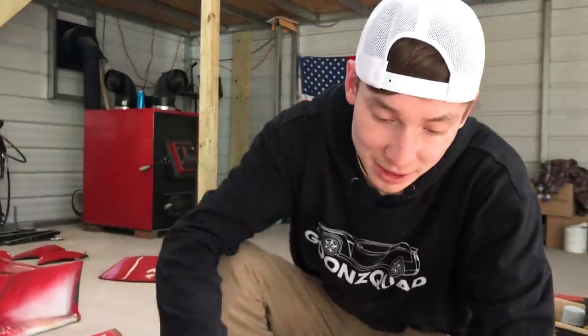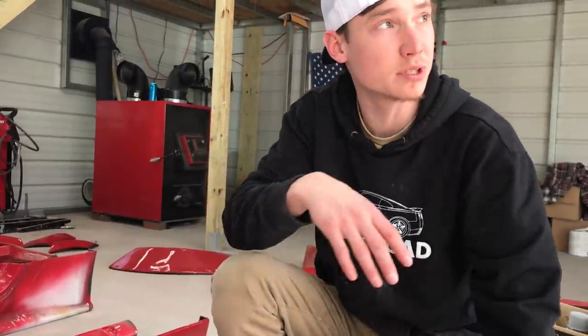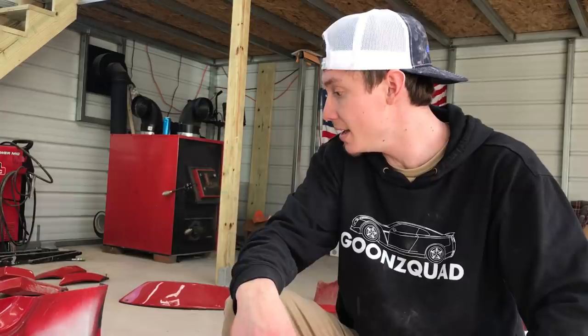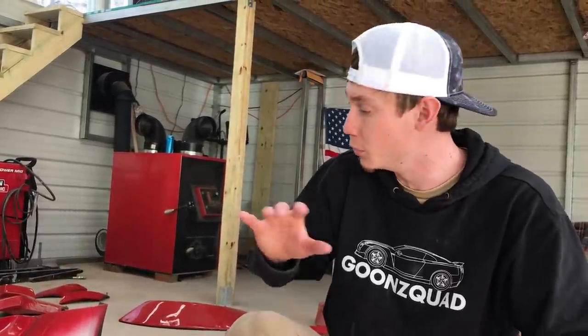Other than that, that is definitely low life right there. We're just going to sand the whole fender with a 180. This one's almost ready for primer, and then once we sand this fender and fix that, the rest of this stuff should be easy. Like I said, these fenders were going to take the most time, so we're going to knock this out real quick and then move on.